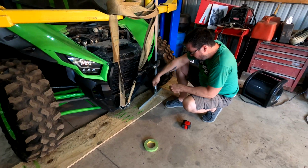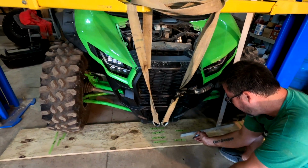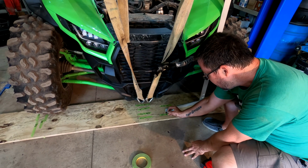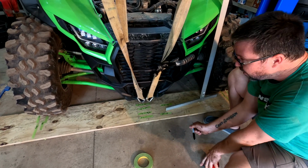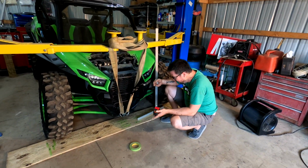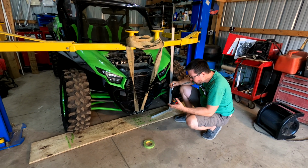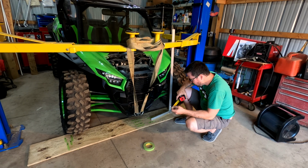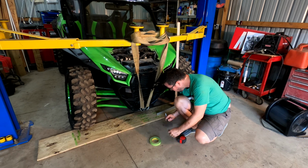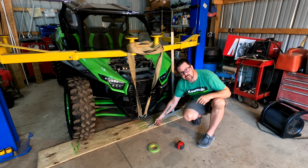So the ratio here was 1 inch front to back. This one is 3, so it's 1.5 inches. So the toe difference between front to rear throughout suspension travel is a 1/2 inch. Then we were going from usable travel. We didn't write down our full compression. Oh yeah, it was 68. So in our usable travel again, in the front, it's a 1/2 inch of scrub.